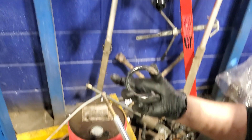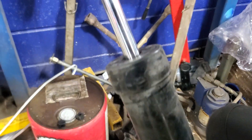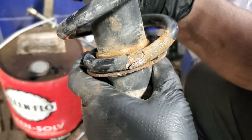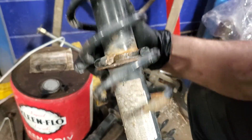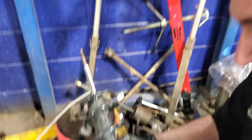This is one of the old struts. This is the lower coil on this — the lower coil sits on that. But once that breaks, this portion... the vehicle drops. It's a progressive coil because it can no longer sit in the spring seat. And this will drop right down — you're basically sitting down on your bump stop from there on out, which is not good.